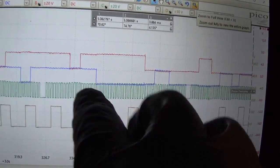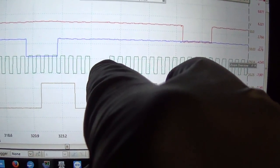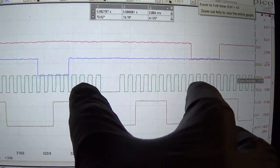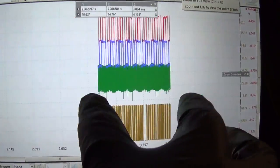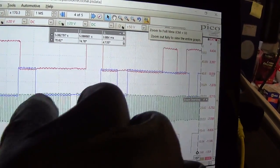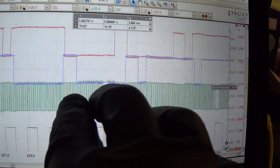So we can actually check how many humps we are away. So like 1, 2, 3, 4, 5. And it's a 60 tooth crankshaft pattern. So every tooth is 6 degrees, right? Since, you know, 360 and one between two sync notches. So I just wanted to find a spot where we were actually advanced. Okay, I think right there. That would be a good place to look. See how many teeth advanced we are there?